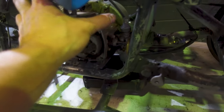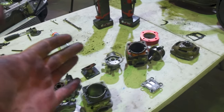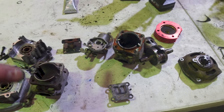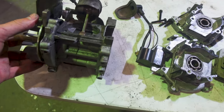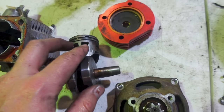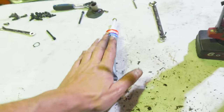Currently in the cart, we have this old motor that I pulled out of one of Cam's carts. He's hard at work building his own drift cart, and we'll hopefully be tandeming later in this video. We have a whole other engine that we're going to build and make all the necessary mods to, to maximize the power. I searched for a big bore kit, but it turns out these motors already come with a maximum size piston — the 44mm diameter piston. This is a bone stock normal motor with no window in the piston, whereas our high-performance motor has windows in the piston, meaning less rotating mass, and also a lower decked head for higher compression. We're about to make some major power upgrades using just these tools and some silicon sealant — either that, or we're about to completely destroy a motor.